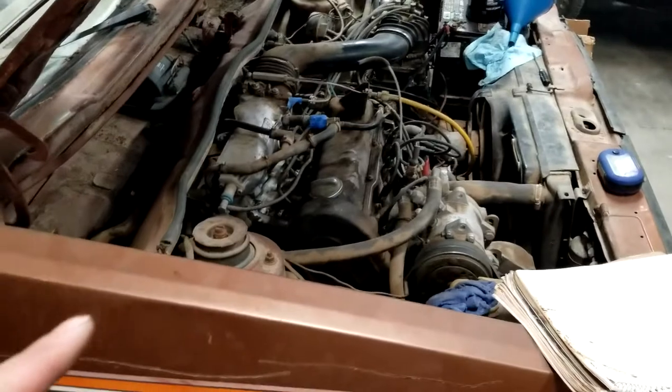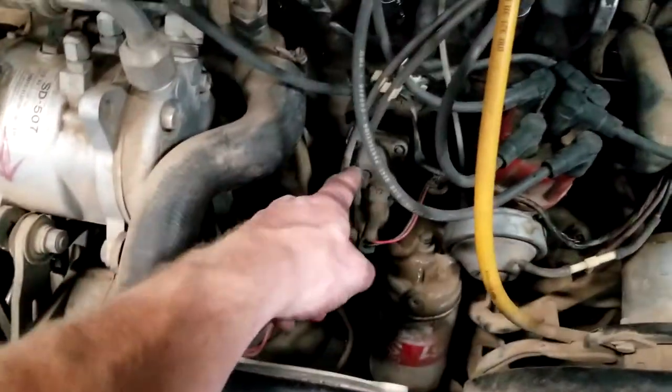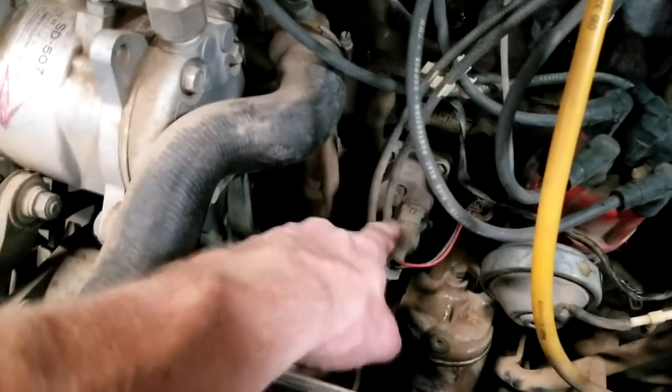Another interesting thing I learned while we were doing this is I originally had it pulling out of a little gas tank right here, and I was only pulling out of it, I wasn't returning into it. I neglected to think about the fact that this car has a full return system. So I kept blowing through gallons of gas. I had 2 gallons in, it ran out, put 2 more in that little tank and it ran out. And I finally realized that there's a whole bunch of complex return system. There's dozens of lines, and somewhere in here is the regulator. I believe this is the regulator, as far as I know. And so that was actually sending the fuel right back into the tank.